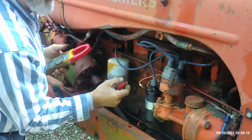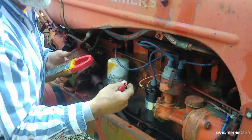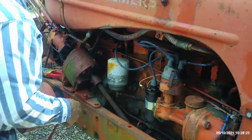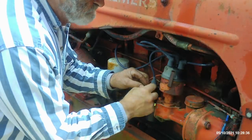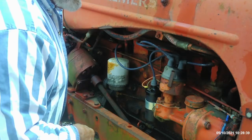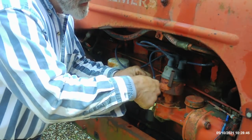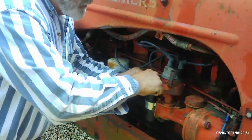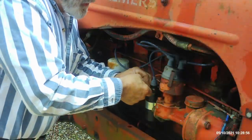So if I've got power coming to the coil, through the coil, out of the coil, and to the distributor, that means my points will be ready to fire. Now there are certain things that might keep your points from firing — it could be corrosion on the physical contacts, burnt points, a bad condenser, or other reasons. At any rate, I'm going to mark that switch which way is on, turn it on, and see if this thing will turn over.